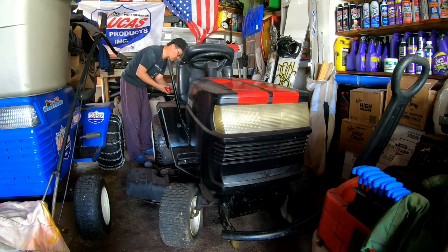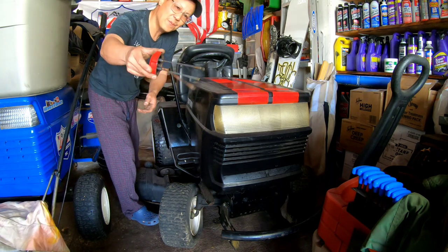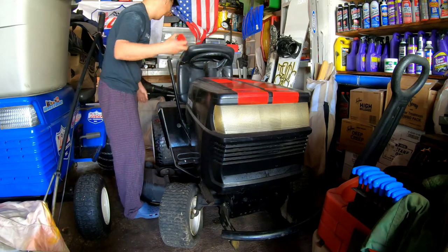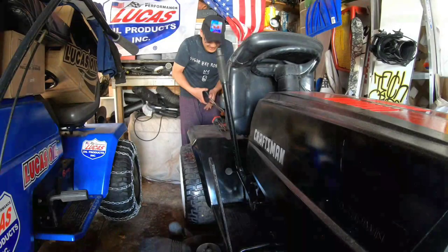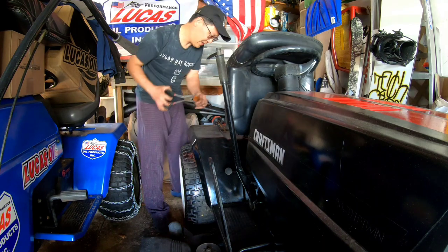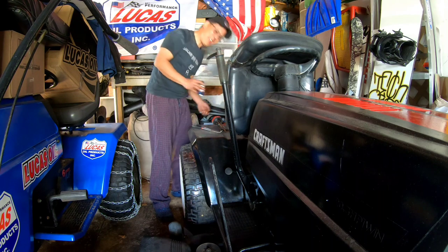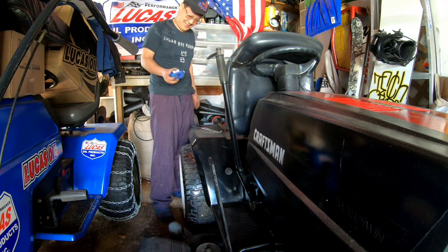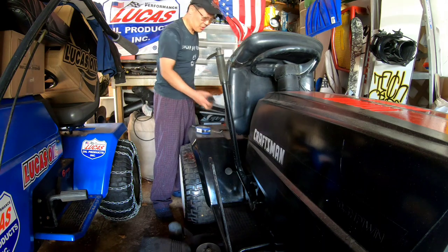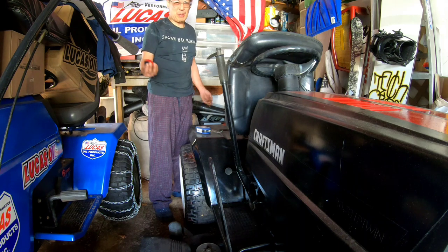That's a possibility. Uh-oh. I just took the gas cap off and the bottom float is missing from it. So I think it fell in. That's not good. Got the float out, and guess what? I looked inside. There's no gas! That's why! Unbelievable. Could have sworn there's gas in there. There's some, but not a lot. So, that could be good or bad, you know what I mean?